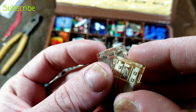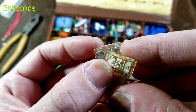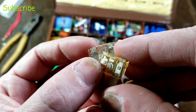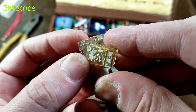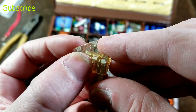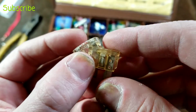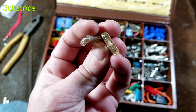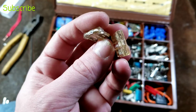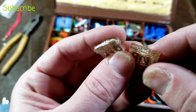The LED remains turned off. But when the fuse pops — when that piece of wire melts down — then it becomes obviously a much harder path for electricity to take, so it will go through the little LED and light it up. So if you have a fuse that's popped, you can just open up your fuse cover with the power on and see which one is lighting up.